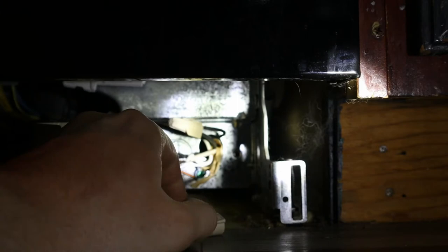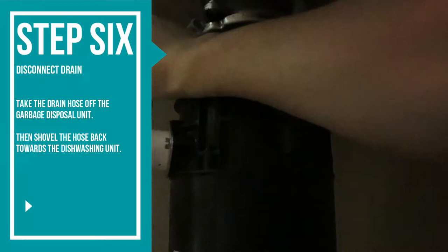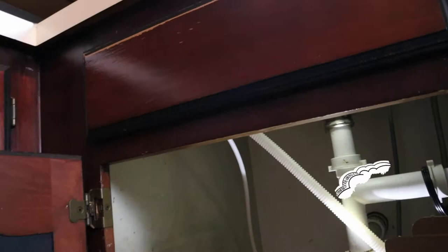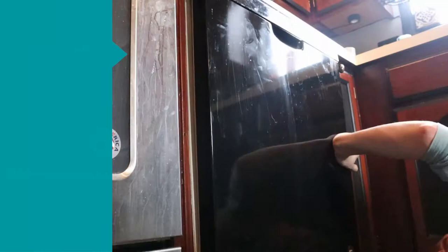Black is the live. You kind of shove the drain back towards the garbage disposal so you have room to shove it back towards the dishwasher and room to pull it out of the cabinet. Take out the top mounting screws — there's one and two — so let's get those out. There are also two electrical connections right here.